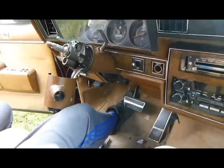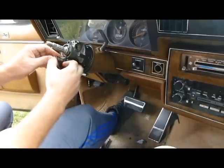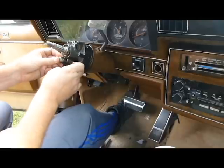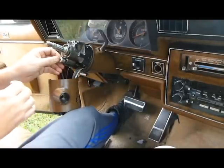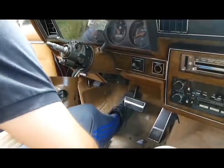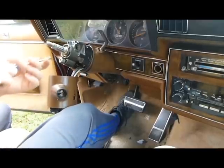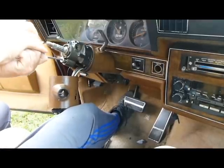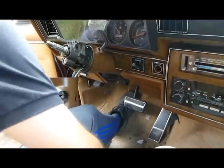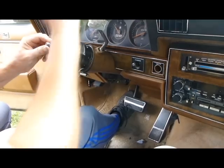Okay. So you put your spring in, make sure your end's still on there, like that. Alright, put the cap on it. Make sure it's on the ball down there. And then, this takes a little more muscle. You take a Phillips or a flathead. Use both hands, push it in there, turn it a little bit clockwise, about an eighth really, you'll feel it notch out. And it's in there. That's your spring that lets your steering wheel up.